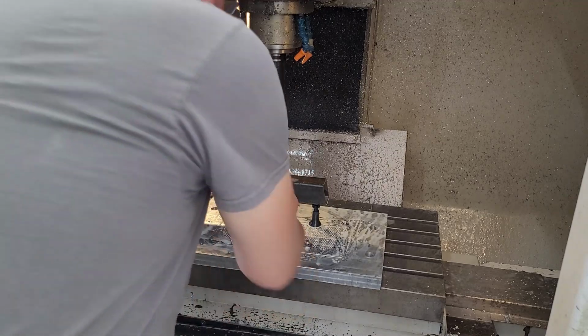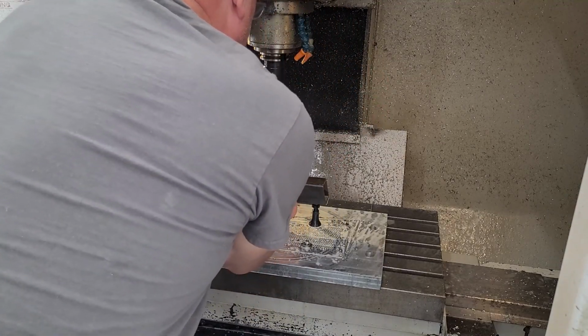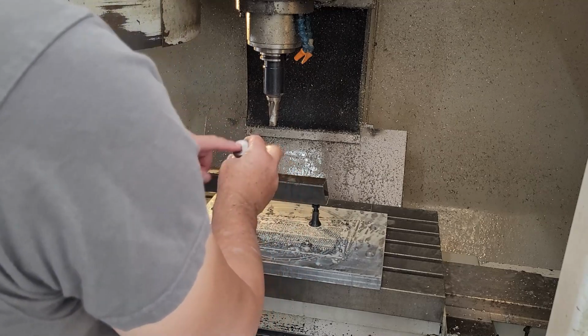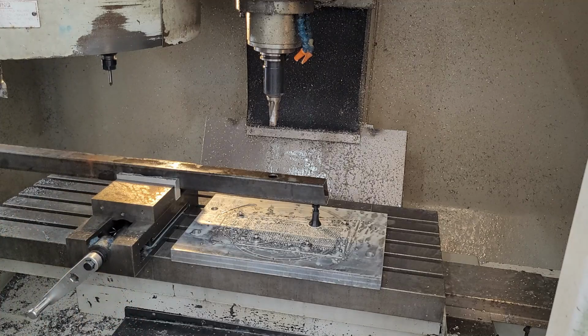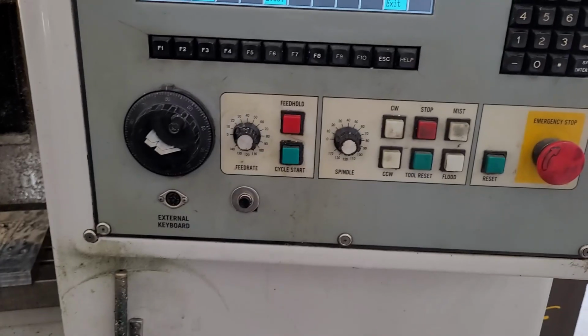Oh, yeah. We need a little deburr action. Uh-oh, we still got a slug down there. Okay, I think that'll work. So we just need to drill and tap, chamfer, put a nice big weld chamfer on there. Let me go find out how far over we need to move to do the next hole. Okay, so let's go.